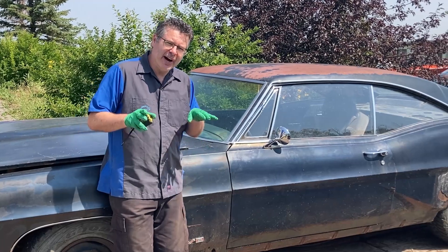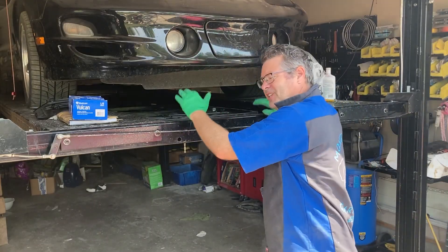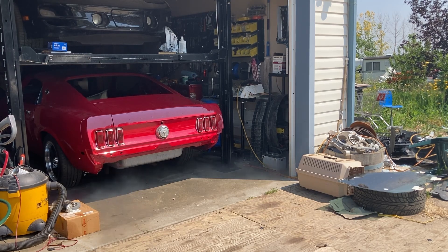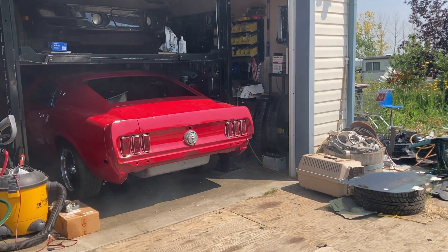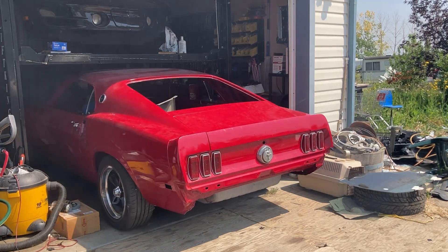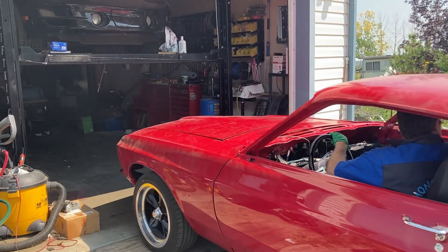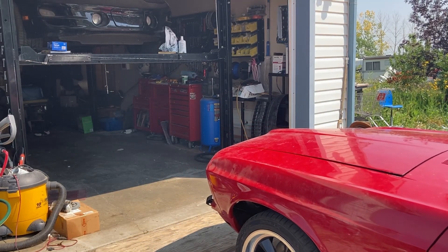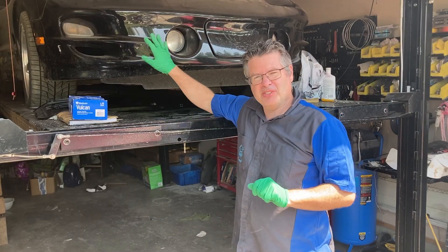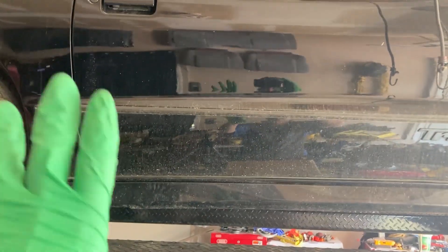If it's something like this car, you might be able to get under it, but it's unlikely. The best option is to use a four-post lift. I had to move something — that is the way to keep your suspension loaded, get under there nicely, and measure. As you can see, our car is sitting on its wheels with all the weight there, same on the front, nice and level. This is the ideal position to have it in when measuring the driveshaft length.